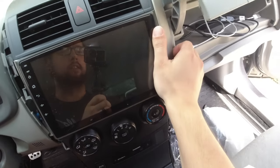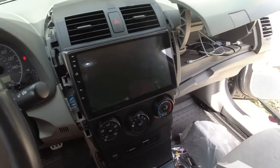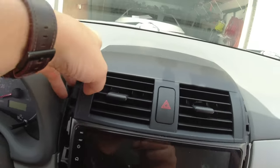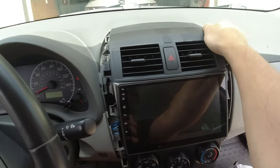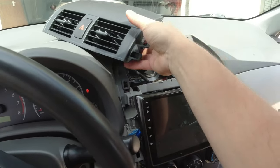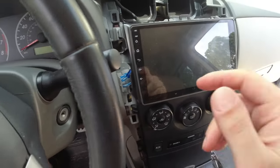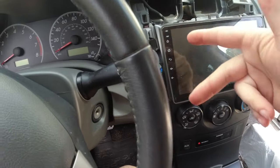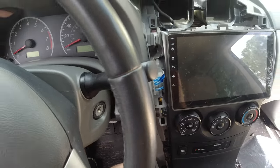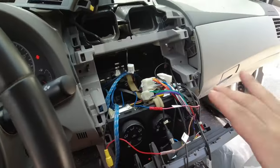The top piece is kind of hard to take off - this is almost the reason why I broke mine. There's no easy way to get to it except to kind of just lift up your upper glove box and pull on it a little bit, making sure you pull straight out. Then we'll pull this off - it's also on here with clips. Pull it up, pull towards you. If you're just taking out the stock radio, you'll probably see a couple 10 millimeter bolts you'll have to loosen up. These radios just literally slide into some notches in here.